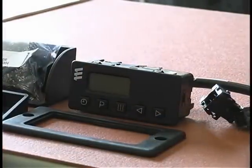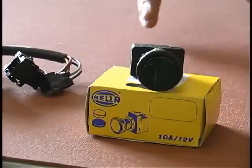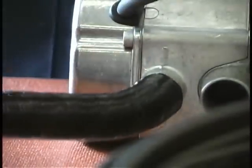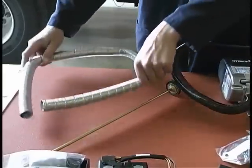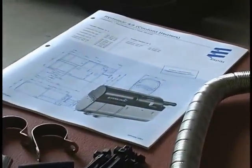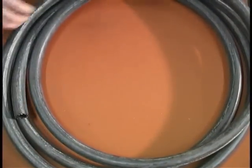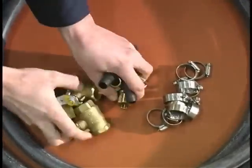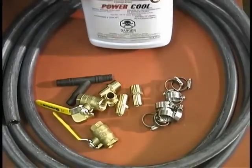A seven day timer with mounting accessories or a push-pull switch. A standard fuel pickup pipe. Combustion air intake tube with the bare heater. Combustion exhaust pipe. Various accessories and a literature package. The user must supply the following components: three quarter inch coolant hose and clamps, three quarter inch coolant connectors and valves, along with coolant.